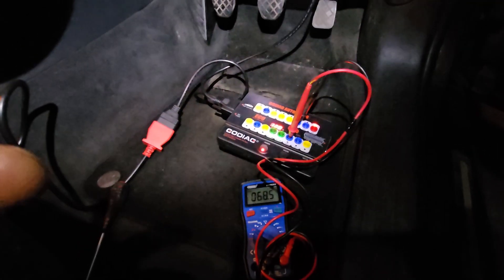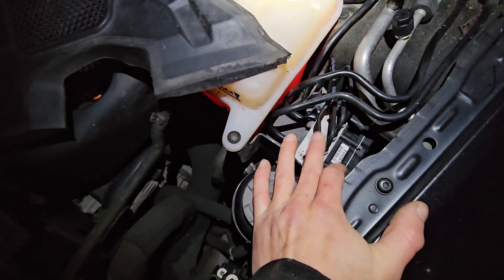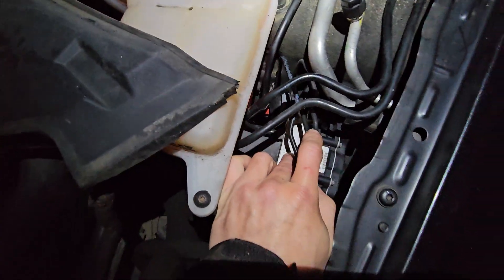I was thinking it must be a module that's got wet somewhere. The parking brake's not working, multiple warning lights on the dash, fog lights, etc. What you normally do with all CAN network faults is disconnect modules one at a time until you get the network back, because a bad module on a network will drop the whole network down and stop everything communicating. Thankfully, the first one I disconnected was the ABS control module — managed to get to the connector, disconnected it, and went back to the car.